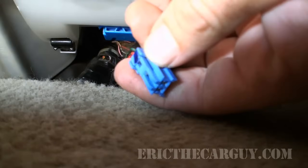One more that might throw you for a loop: the Acura Vigor actually has this located on the left side of the passenger kick footwell, sort of up behind the center console — you sneak up behind that and you'll find the connector there. So just look generally in the passenger area; you may have to look for your specific vehicle and application, but for the most part it's in the passenger footwell area. Look for that blue connector.